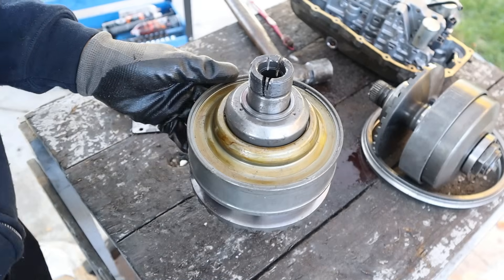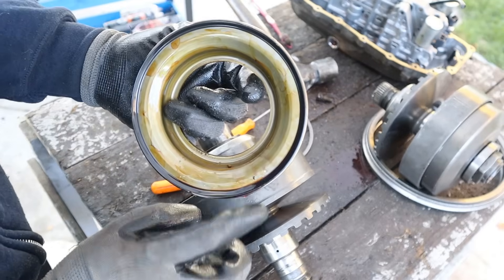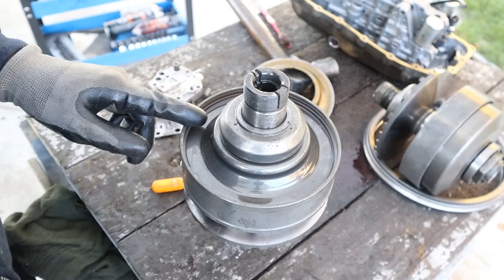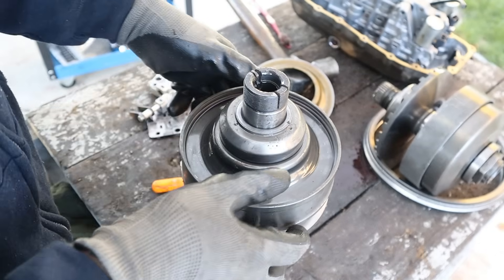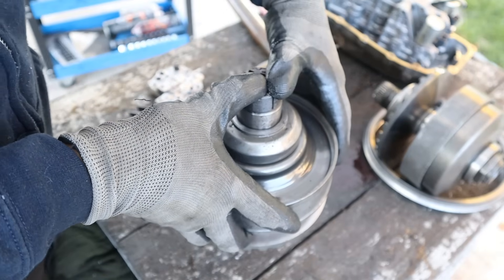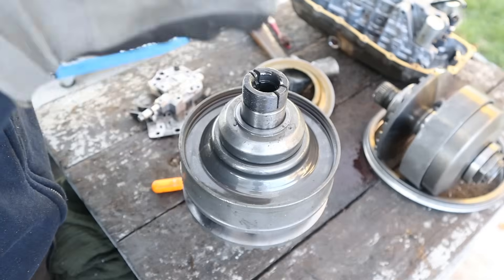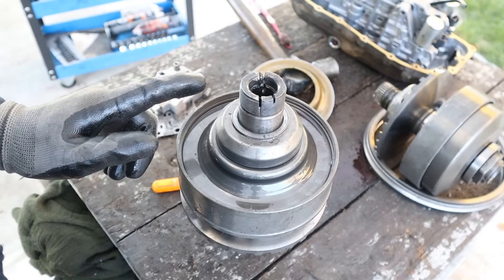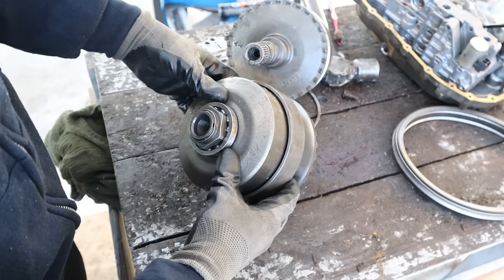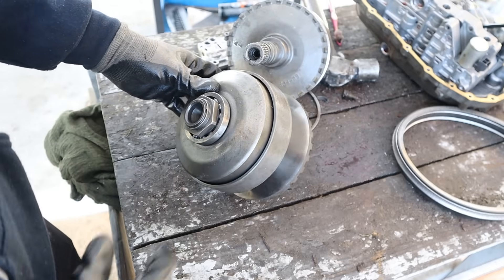I don't think I'm going to be opening this thing up because it's got a lot of pressure. You technically do need a press or a puller to compress that spring, then you can release the ring and the thing can come out slowly — we don't want to do anything too dangerous. On a lot of Nissans, the seals would go inside of here and that will cause a fluid leak, and if you don't have enough pressure to push on that belt you're just going to be slipping away.